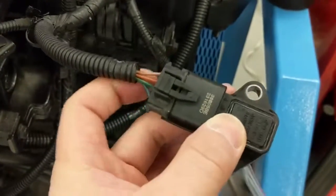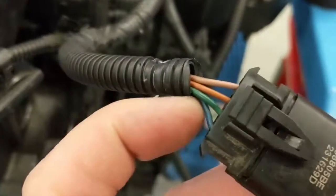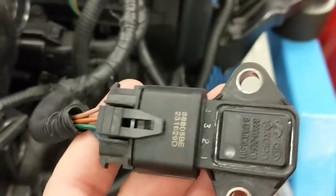Once I put bugs into these things, let's say if I take out one of the signals or take out the power supply, you will need to follow the wiring diagram and actually troubleshoot and get to the bottom of what is actually wrong with the circuit. Also, we're going to analyze what it does to fueling and what it does to the engine when we have a faulty signal.